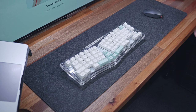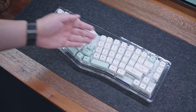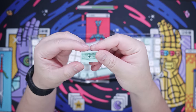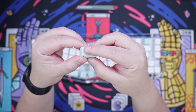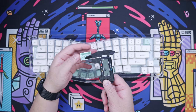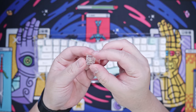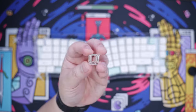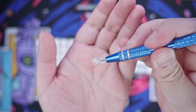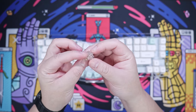Overall design-wise, I like how the XBOWS Crystal looks, especially the fact that unlike the original XBOWS keyboard with non-standard keycap sizes, this one is compatible with most keycap sets. The stock keycaps are made out of durable PBT plastic with dye-sublimated legends, meaning the legends are essentially permanent and the keycap texture will not shine easily over time. The keycap thickness is around 1.4 to 1.6 millimeters, which is decent enough for a single-shot keycap. The switches included are the Gateron North Pole Yellow, which are linear with an actuation force of around 50 grams. The top and bottom housings are made out of polycarbonate plastic, while the stem is made of thermoplastic and is pre-lubed out of the factory. The sound signature is relatively quiet, with a rather sticky or squishy feel when you press and bottom out.